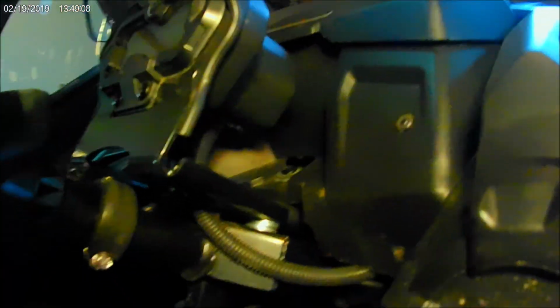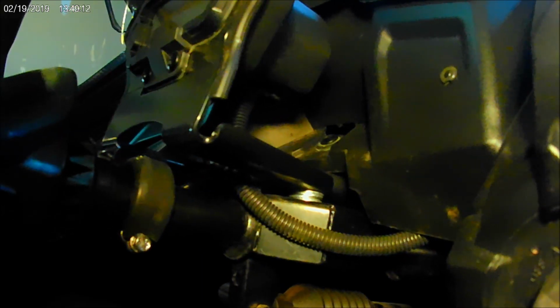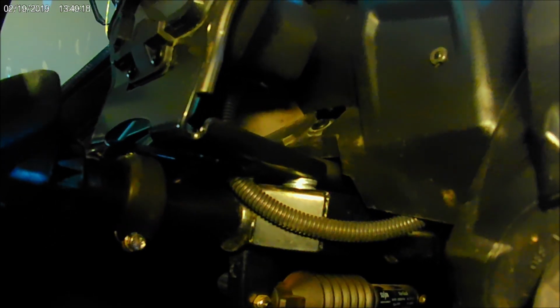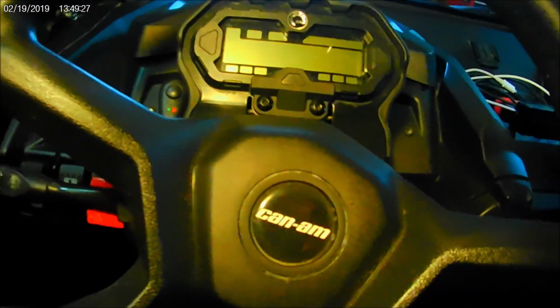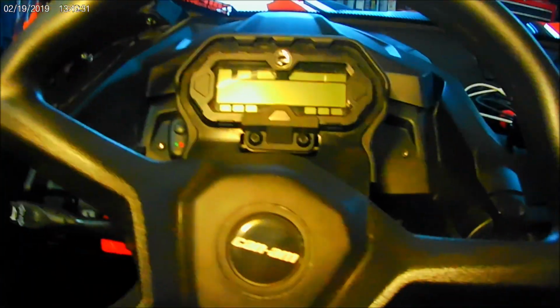Let's see if you can see them here. I ended up shimming up the instrument cluster on a number of washers so that I could get that signal unit up and horizontal, and I'll look for some plastic standoffs to do that a little later, but that helped with getting the stock up far enough to stay out of the way of my knee. We'll turn it on now.